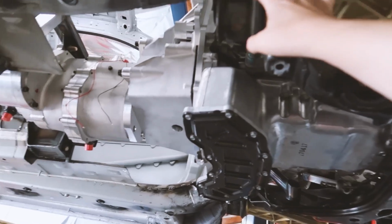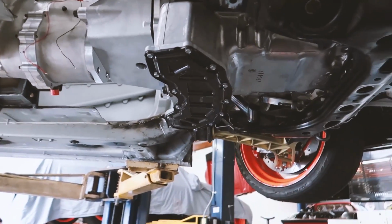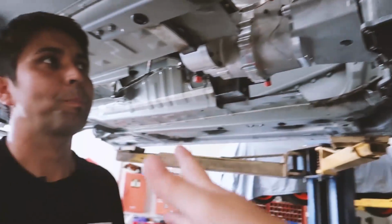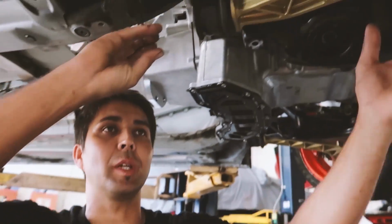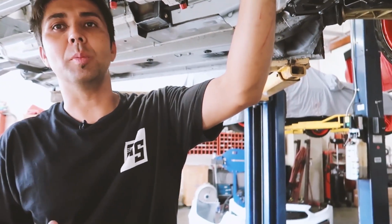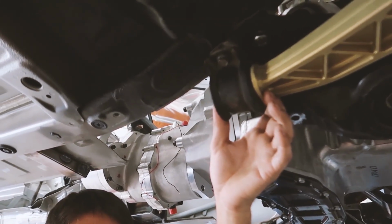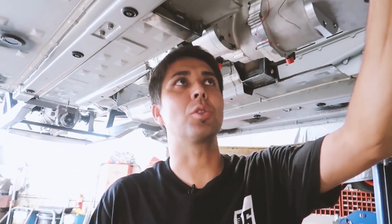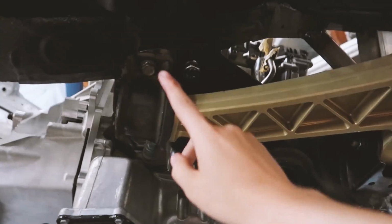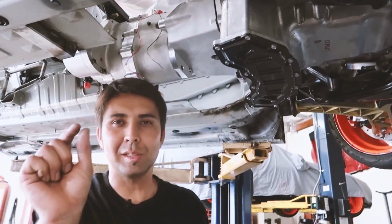Oh, and last time I did forget in the front. We talked a little bit about how you decided, instead of using the Heim joint, to replace it with a bushing. Will you just really quick, again, from your experience, say why we're doing that? From my experience in drifting, making everything Heim joints is great because your suspension moves smooth and works great. But for drifting, I believe that having a little bit of give is good, so you don't bend your actual subframe. You want to have fun, get close to your friends, give them a little bump, you know? Yeah, so it's nice having a little bit of give, just a little bit of leeway.